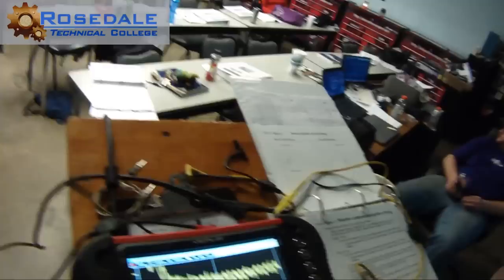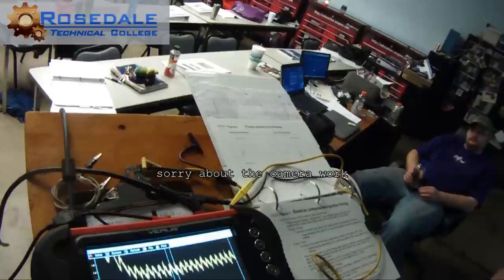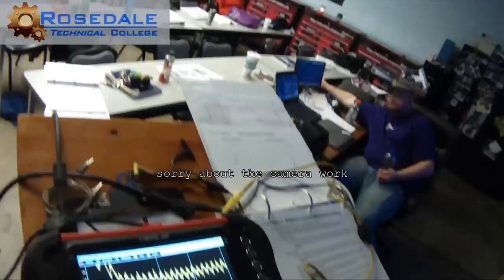And what I look for simply is this: start at one point where once the amperage has stabilized, start at one point and count six. So 1, 2, 3, 4, 5, 6, back to one again, and those all look even. So good news for you is your misfire most likely is not compression related. Okay. How cool is that? Good. That means like all the plugs you took out in engines class, and that looks like a good compression engine. Okay.